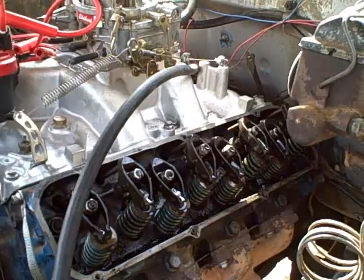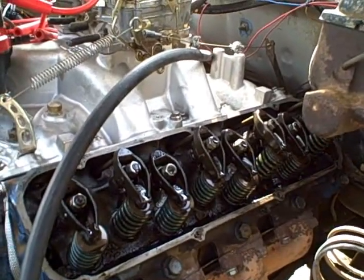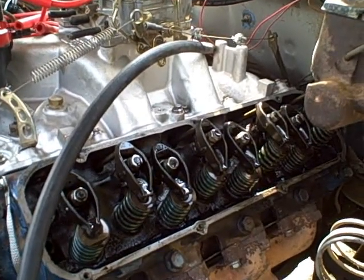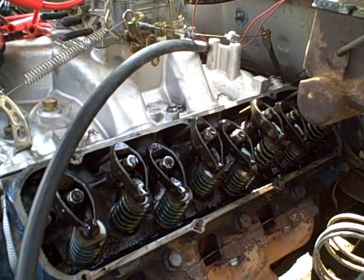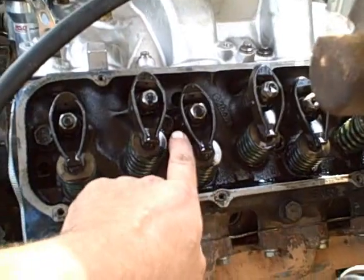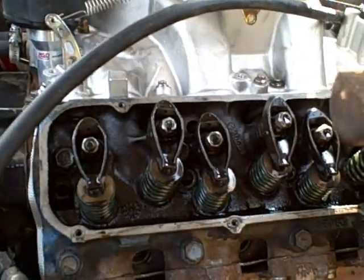I'm back now, and there's one problem with this picture. I'm used to building Mopars and I don't recall having this issue with them, but when you pull these heads off you have to pull all the rockers off because you can't get to all the head bolts — there are head bolts down between the rockers, so you've got to pull the rockers to get to them.